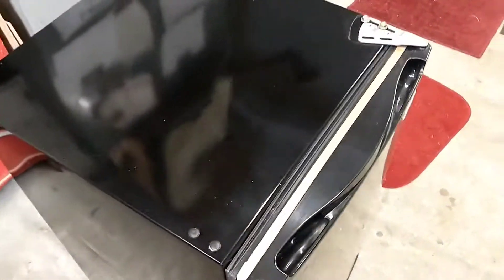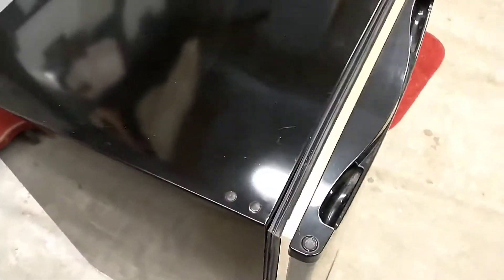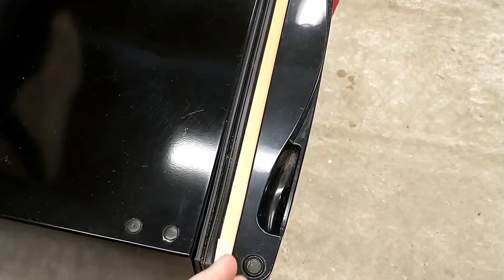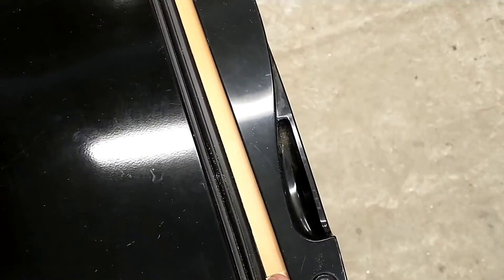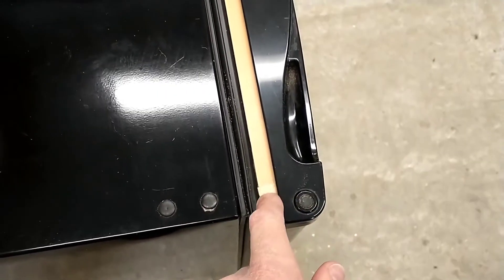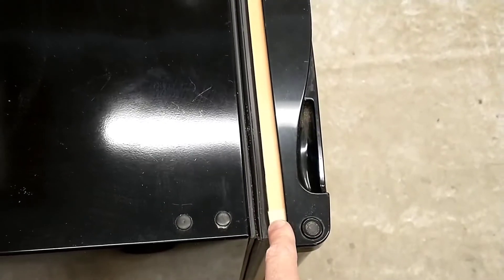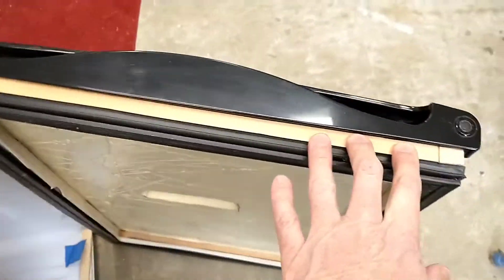What I did instead — it turns out my pail only sticks out a little bit. So I removed all of the liner from the door — I'll show that in a sec. And I added this half-inch wooden shim that I just sawed out of strips of wood. You could probably come up with something pretty readily from Home Depot. And then I reinstalled the magnetic gasket.